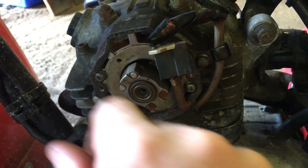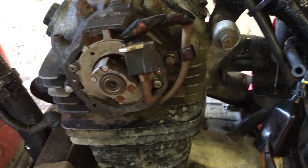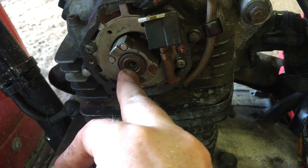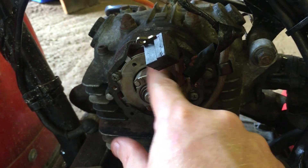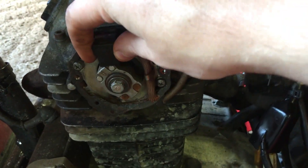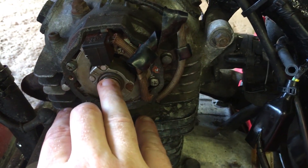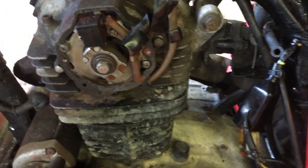I've got the plate on and the screws tightened. I'm going to put the bolt on and tighten that up. You can look up the proper torque spec — I usually just go snug, tight enough that it won't loosen but not overtightened. Now the only thing left is to put in the two screws for the sensor. I'll go grab my feeler gauges. I set mine at 18 thou, but the manual says 15 to 25 thou, so I aim for roughly the middle.